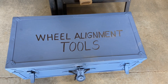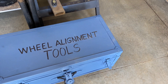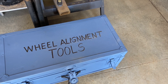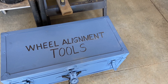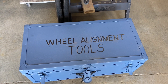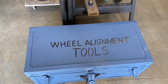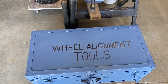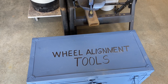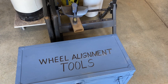I was having problems with the car — when I take it in for an alignment, when it comes back, it's not adjusted, or one side is not adjusted. They don't tell you that one wheel is not adjusted properly. They put the lasers on, put all the frames on, and as long as it's in the green they don't care about the actual angles. If it's red they adjust it, and when it goes green on their software, the car is done. But this is just not good enough. I'm getting about three different alignments and each time it's just not in spec.